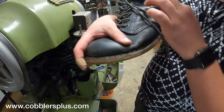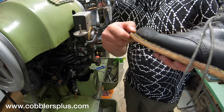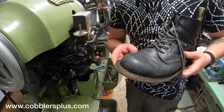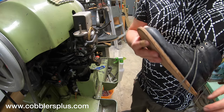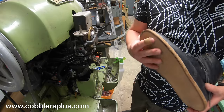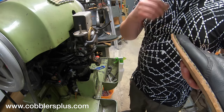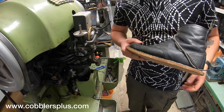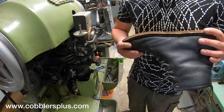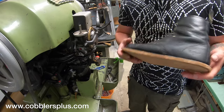It's sitting inside the channel, and basically what I'm going to do is go through our welt press and press everything out all around, and it's going to close it up even more. And then afterwards, obviously, I got to touch it up with some acrylic paint around everywhere. These things are going to be shined up anyways afterwards, and during that period, we'll be able to touch all that up. I just got to be careful a little bit more to not hit that yellow stitching, because that's really something that you don't want to screw up too much.